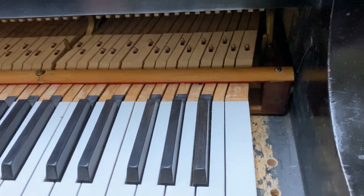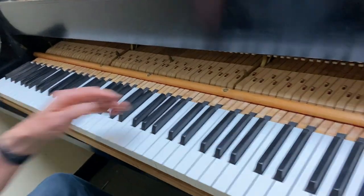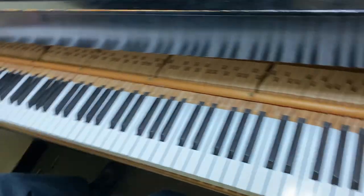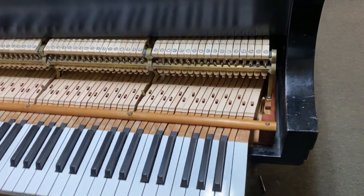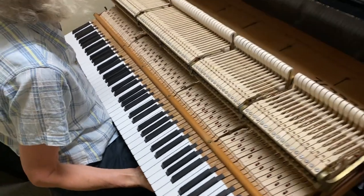This one's not wanting to come out easily — this is a good demonstration. So I'm not using the pins, but I just use pressure so I can start it out. I start it out on this side with the spring, and now again not using the pins but just pulling out the frame coming out straight — and now you have the action out.